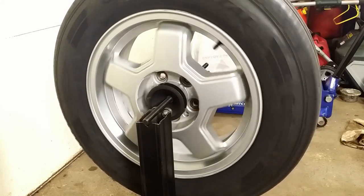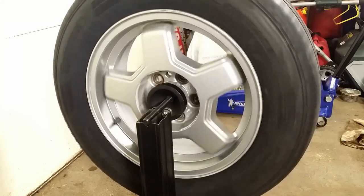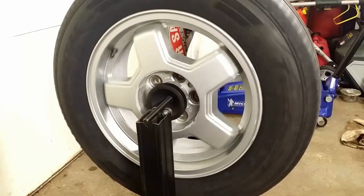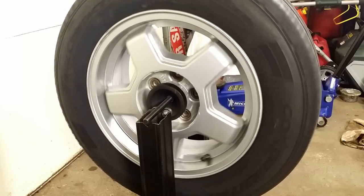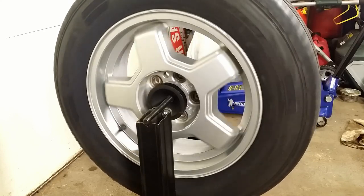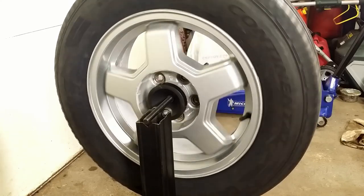What I am doing is called static balancing. My objective, that is hard to reach, is to evenly distribute the mass of the wheel. It will never be perfect, even with a machine, but we can get close enough to minimize vibration.